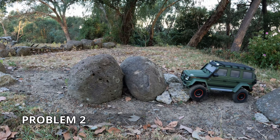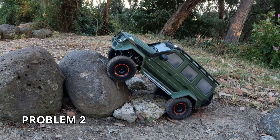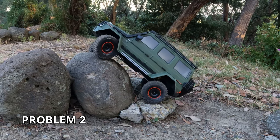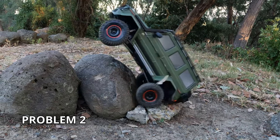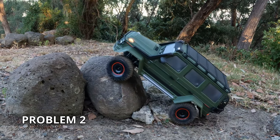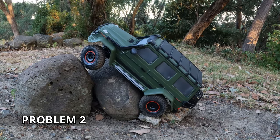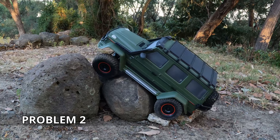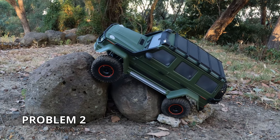Diffs are locked. I had to pick this car up and line it up properly because there's no way you can just drive into it. These Hyrax clones — Hyrax is a great tread design. The compound feels good and sticky when it's clean, but now it's all dusty it has a lot less grip than the real Hyrax, even the G8. It's difficult to judge whether this is a question of compound or foams — the foams could definitely be better. And I just got distracted and lost it at a crucial time.